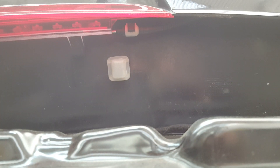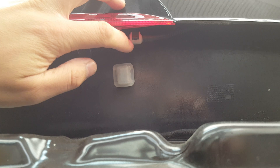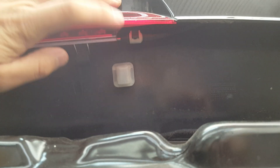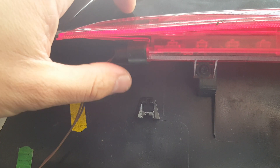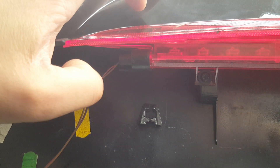So that's the only thing holding it. Then you're going to have a pipe connected in there — you need to pull that black bit off and it unlocks it, then you just slide it off. That's the washer jet. And you're going to have a plug on there — you just need to squeeze the plastic bits in and then it unplugs. This is already a new light so I don't need to do it.